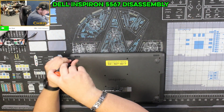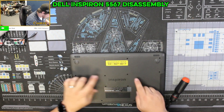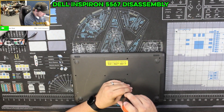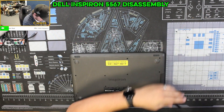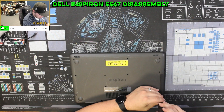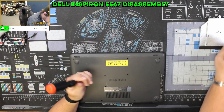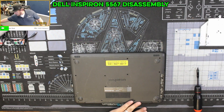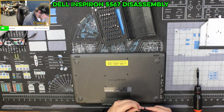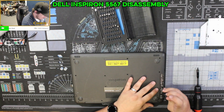First, on the bottom you're going to see how many screws we have here — one, two, three, four, five, six, seven, eight, nine, ten, eleven, twelve, thirteen, fourteen, fifteen, and there might be a few more underneath this rubber strip. These are all standard Phillips heads. With the smaller ones I recommend having a precision-style toolkit — iFixit sells some with nice small tips — because the heads of these screws are extremely fine, and if you round them out you're never getting the computer apart.